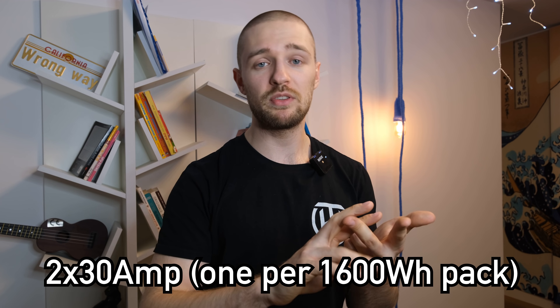In the EXN with a 6P battery pack, the maximum should be around 42 to 50 amps — not 130. A 130-amp fuse is a number that would never actually be reached because the batteries would explode first. The fuses should be around 50 to 60 amps depending on the wheel to keep them safe. That's what Inmotion and KingSong do — and what the Veteran Sherman does. Sherman initially had 50-amp fuses, then changed to 30-amp fuses which is actually the right number. On Gotway the fuses don't change anything meaningful — they could practically leave them out.